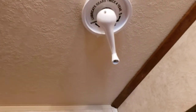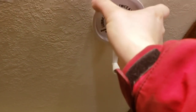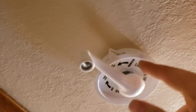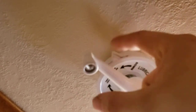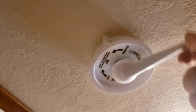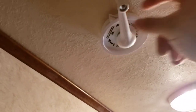Your antenna — you crank this up right here, go all the way up, then pull it down and turn it to aim. If you turn it and the alignment arrows end up not lined up, before you lower it you have to get the two triangles aligned. There's a little cradle on the roof that it sits in, and that allows it to stay lined up when lowered.